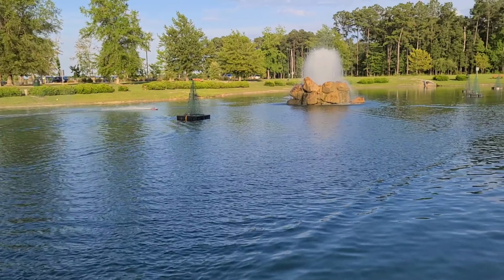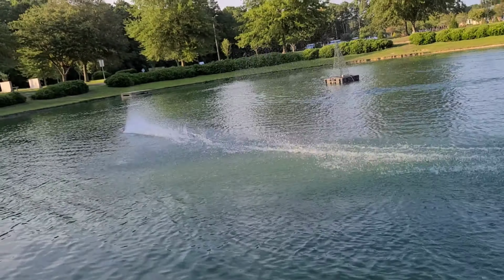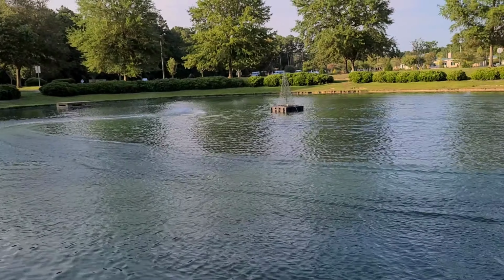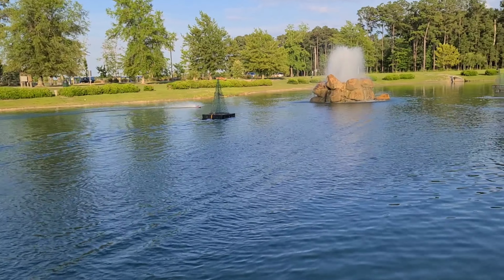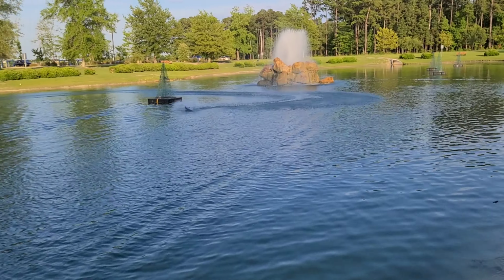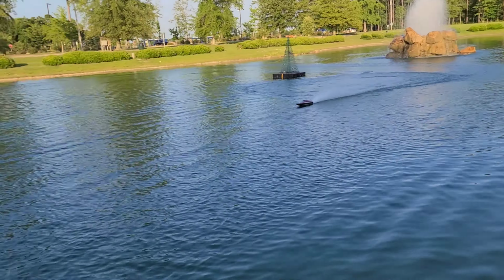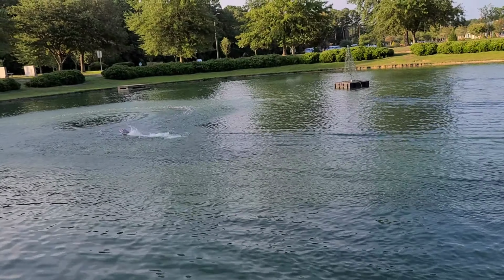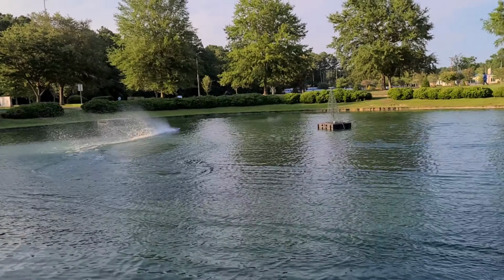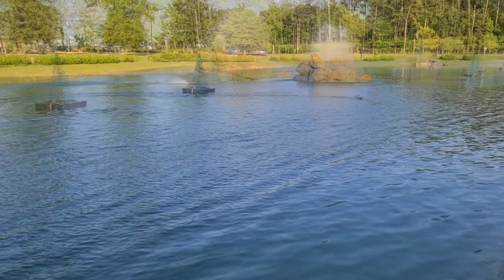The M440 prop is actually a good prop with the stock electronics. It's a really good prop. You'll pick up an extra 5 or 6 miles an hour with an Octura M440. With these electronics, it's only about 100. The electronics alone are 100 grams or so heavier than the stock electronics.